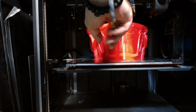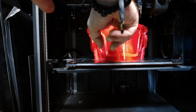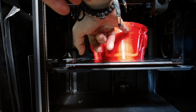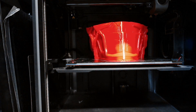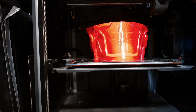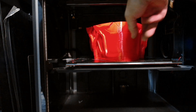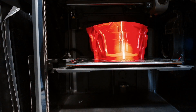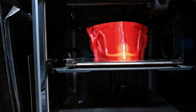You can see my little model in there — I'm doing a Spider-Man helmet, but the print head got caught on something. I'm finding out that if I have it orientated straight on like that, it tends to catch. I'm not sure what's happening because I'm not watching it, but I've noticed it's caught on something and moved the print head. If I put it on a 45-degree angle, that doesn't seem to happen. I've been doing a lot of T-rex skulls and if I've got it on a 45-degree angle it prints the whole thing; if I've got it straight on like this it actually catches and causes a problem. So if you're printing large things, put them on a 45-degree angle — which I've got to do on this one — to stop that sort of thing happening.